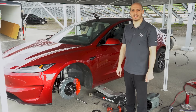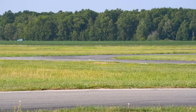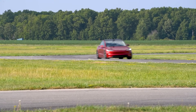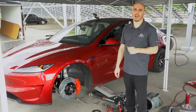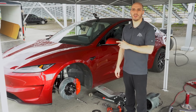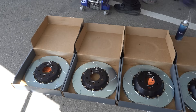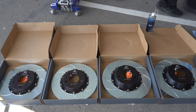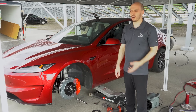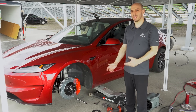That third session was pretty good — disconnecting the rear bar was the right move. Car felt really good and easy to get in on the entry. The main problem was I couldn't slow it down for the first corner. But we did a 1:14.8 — that's already beating our best time by a tenth. We had already started overheating the car at that point, so there was power limiting the entire lap — we were down about 50 horsepower. Once we have the brake pads on we'll try again. I think a 1:13 is possible, although maybe not today — it's really hot and humid, the car overheats faster and the track grip just isn't quite there.